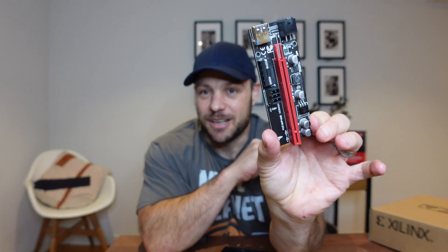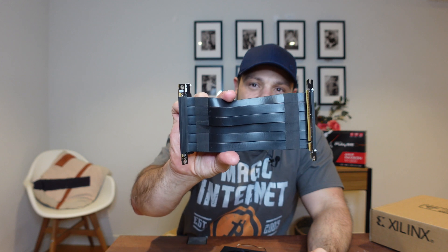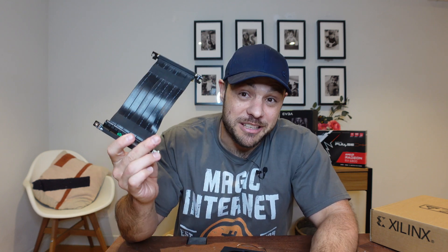It just kept saying it would start and stop. Ultimately I swapped out all sorts of stuff and early this morning I thought let's stick it on the motherboard and try something different. So I ditched the typical riser you'd find on a mining rig and replaced it with a riser from my gaming PC — a gen 3 x16 riser. I recently upgraded my gaming PC and replaced it with a gen 4 x16 riser to get maximum performance from my gaming GPU, so I kept the old gen 3 riser for proof of useful work.